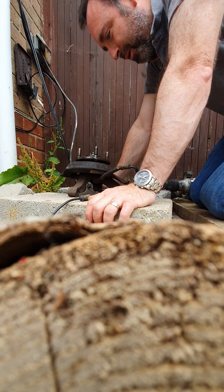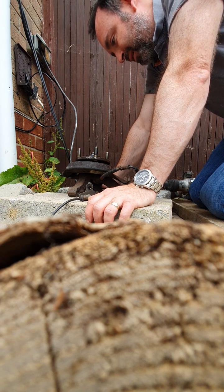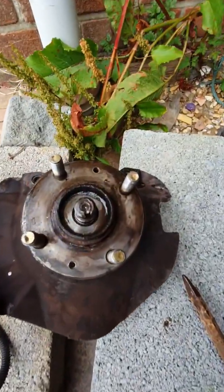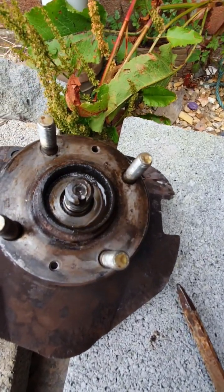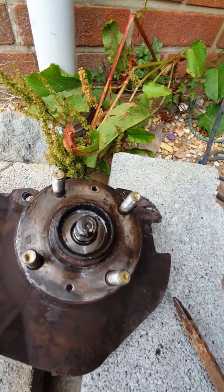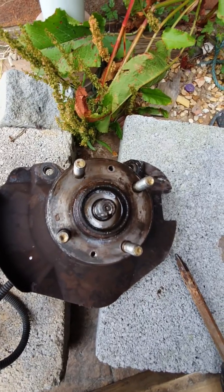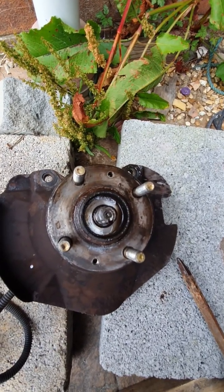You kind of get tricked because you think it's gone down a bit, but I don't think it has — it's made a big hole in the middle of the metal, about doubled the size of the hole in the middle of the drive shaft. It hasn't actually moved it out at all, which is a shame having been soaked all night in WD-40 and then beaten with the SDS hammer. I would call that a fail unfortunately. So the answer to the question is: if you use an SDS chisel on a really stuck drive shaft, you probably aren't going to be able to get it out.